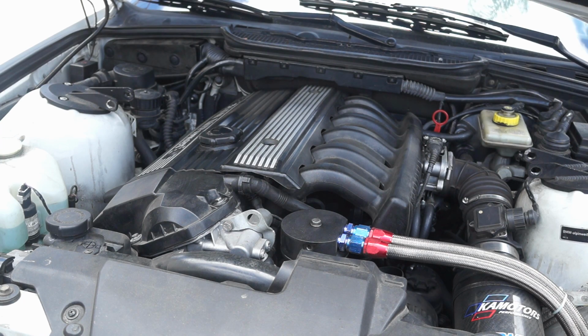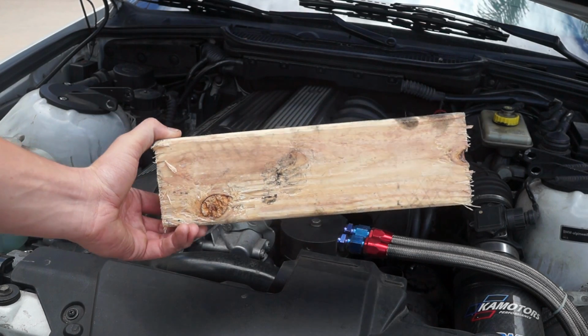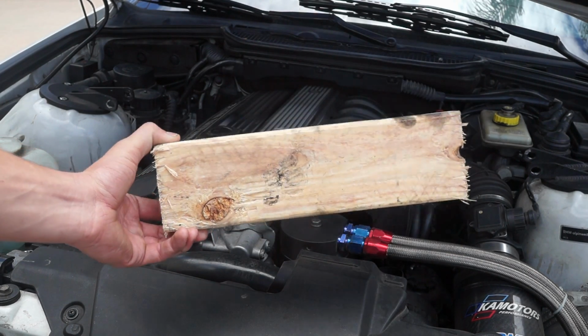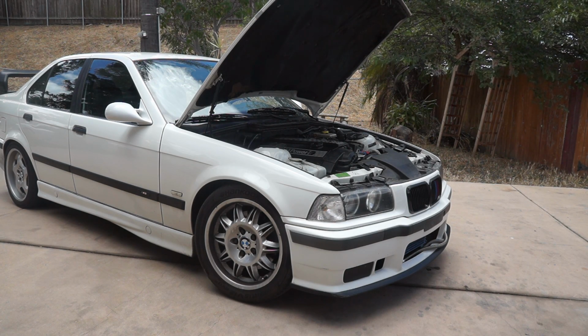So I'm going to be using that today in conjunction with a piece of wood here and jack it up by the oil pan. I'll show you guys how to do that later on just to get the weight of the engine off. Now, the majority of the work is going to be done underneath the car, so we do need to get this thing up in the air. I'm just going to be lifting the front and putting it on jack stands. I will leave a video link in the description for you guys to jack up your car if you don't know how to do that.